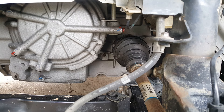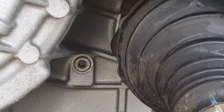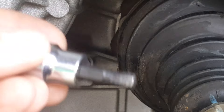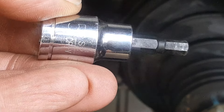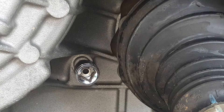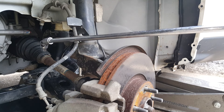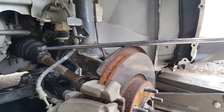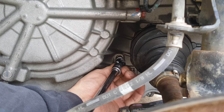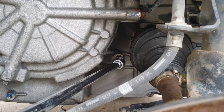You see where we're going — right in there to the left of that CV axle. I'm going to put a little pan under here. Now, you could have a different plug — this is going to be a 5mm hex Allen. We're going to be using this 5 with a little extension. You want to have some gloves because this is going to be warm. I'm going to be using a 2-foot extension with a swivel on the end.